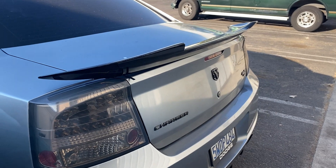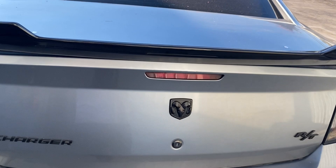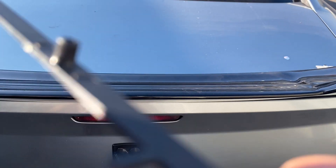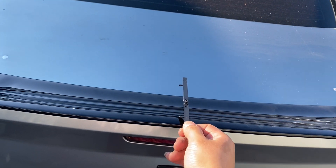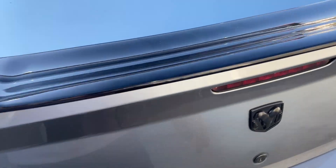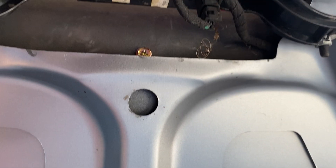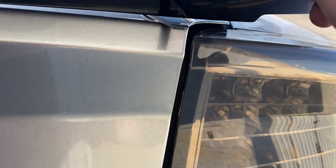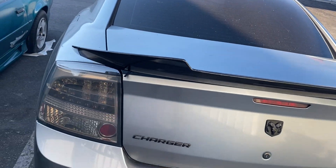Here's what I've done so far. I got the spoiler centered and used this to help guide where the hole was — I taped it on where the hole was. You see, that goes in where the bolt goes in. You put that on there, it sticks out — like these, you see, right here and right here. So once I centered it, I taped it down so when you lift the spoiler up, that piece stays right there so you know where to drill through. I screwed in the center one already just so I can line these up, because there's a gap — you gotta force it down. Now I'm going to take the spoiler off again and drill the holes where I taped them.